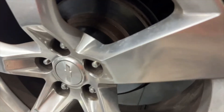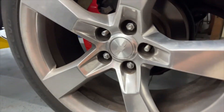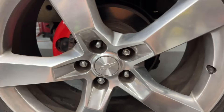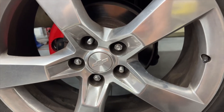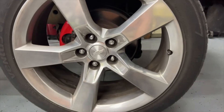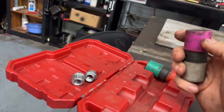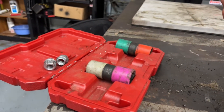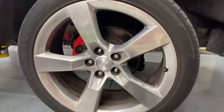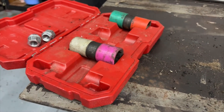The back one's got some road rash on it and stuff. But it's a different bolt pattern. As you can see, there's a spacer here. I put a little Loctite on the spacer threads just for peace of mind — you don't want those things getting loose driving. I know it's not ideal to have these lug spacer things, but I'm driving it quite a bit and it works pretty good. My brother got me this set — it's for wheel lugs and they've got nylon or some sort of polymer on them. It's six of the common sizes, so you usually just grab this little red thing and you're good to go. Take off any tire and wheel you come across. These are impact rated too.